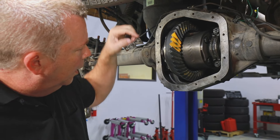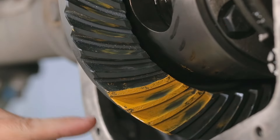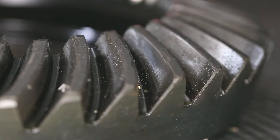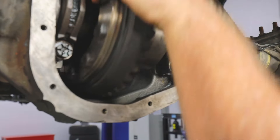The opposite is too deep — at the bottom of the gear you get a flat edge where the pinion runs off the ring gear, and then you see the top of a hamburger bun. Whether too shallow or too deep, the teeth are not approaching each other at a parallel angle — they're not coming together smoothly and flat. That's what creates that defined high or low edge. When you have a bad angle, the gear rides on the edge of the tooth, and at a minimum you get noise.